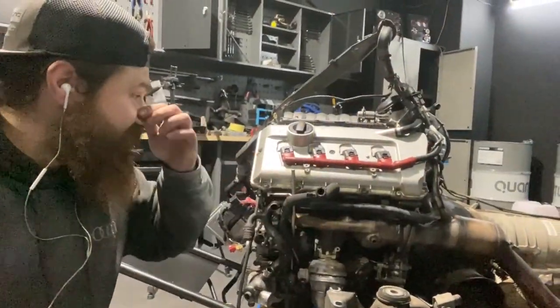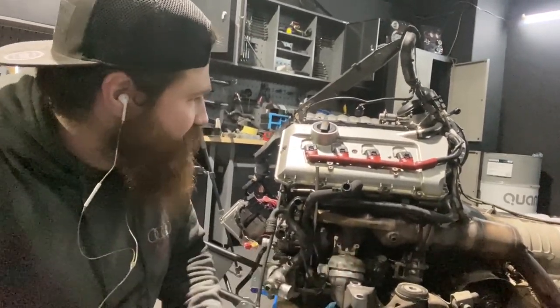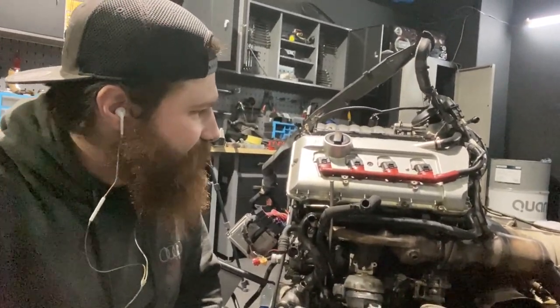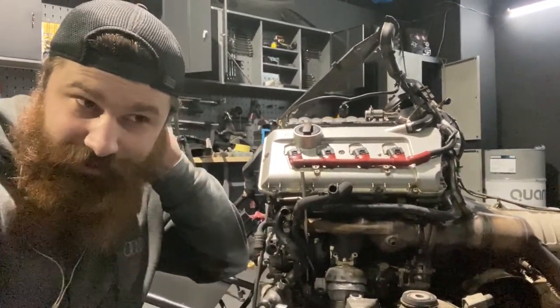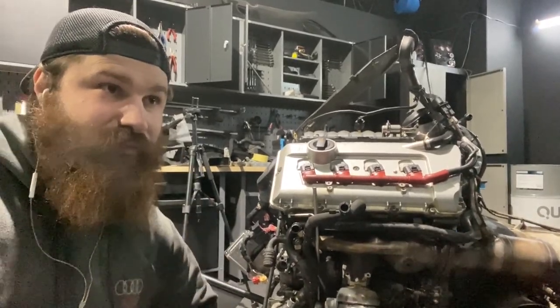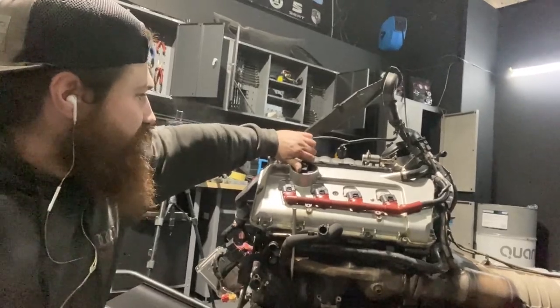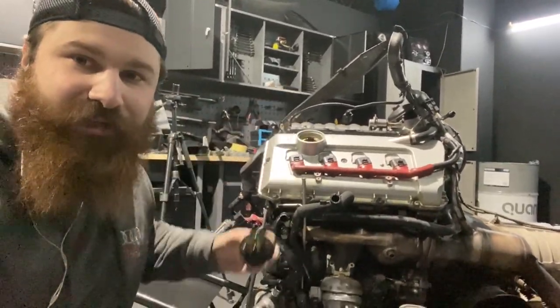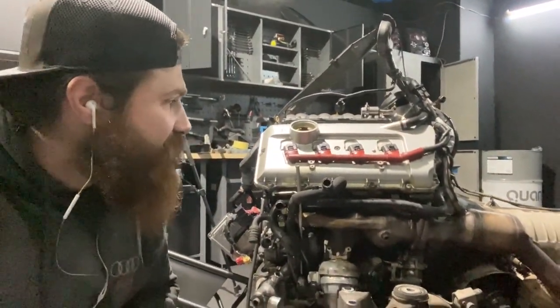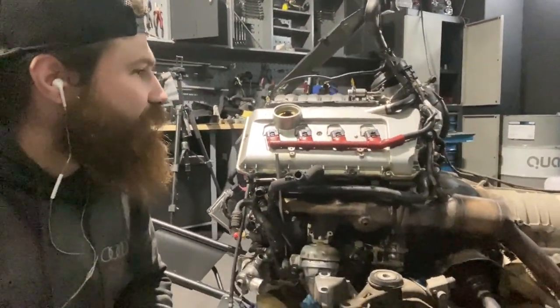So yeah, the V8 is outside the car now. We're gonna start stripping the exhaust, take the whole loom off, and the gearbox needs to come off the engine. We did find a few more issues as usual, more oil leaks, the CV boots gone as well. The only way we're gonna find out what we're actually gonna do on the timing chains is to split it all and take all the covers off. So yeah, let's do it, and hopefully we're gonna know the result today.